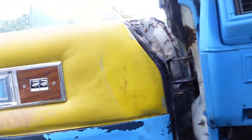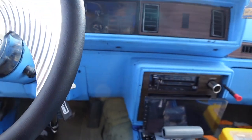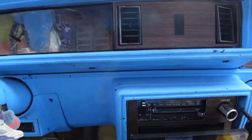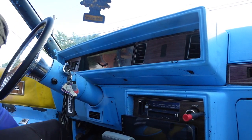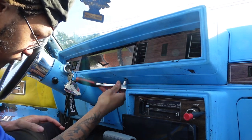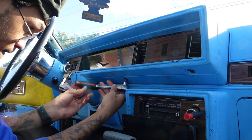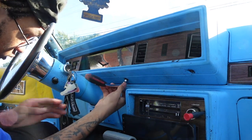Got that back in — that was the first step. Now we can go ahead and get into taking off this dash. Like I said, it's just four screws on the bottom. My bolt is a seven millimeter — I don't know if y'alls are the same, but my car is all original. If yours is all original and you didn't change these screws, it should be seven millimeters. I like to stay organized so I'm gonna keep everything together so I don't lose nothing.